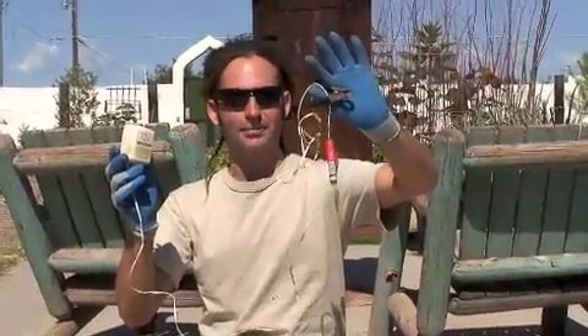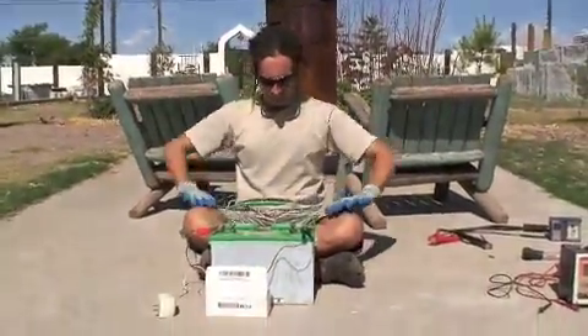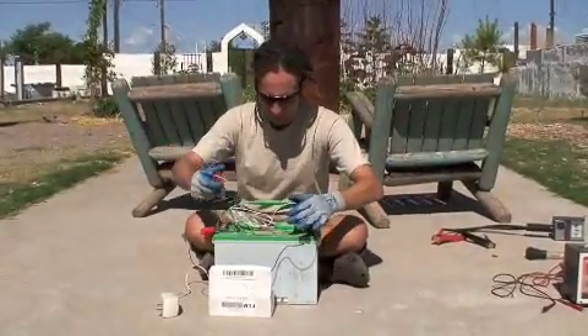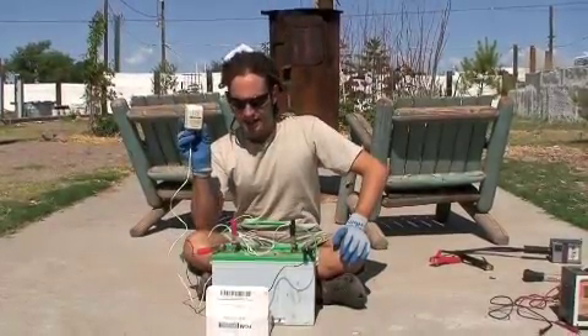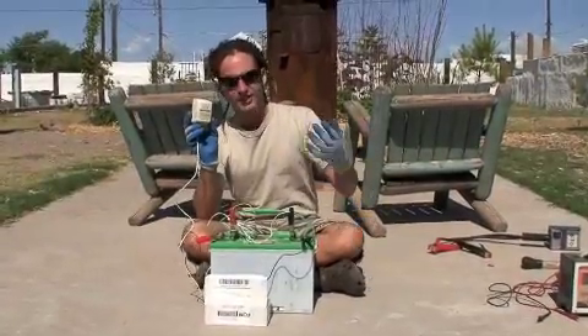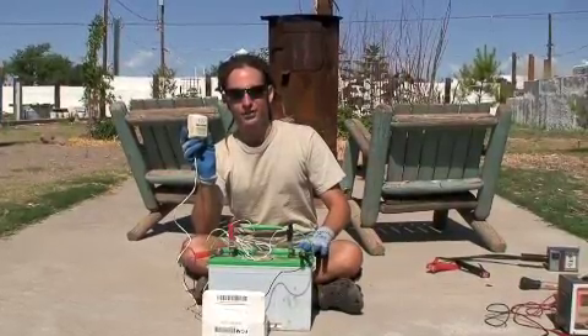This is a 12-volt wall wart plug — the standard kind you'd see in your house. You'd probably have boxes of these in your garage. All I've done is put some nice battery clamp leads on the end of this one. What I like to do is, while the desulfater is plugged in, plug the negative lead and the positive lead in the same fashion, then plug this into the wall outlet. The idea is that while the desulfater is running and taking energy out of the battery, this charger is trickle charging the battery and making sure it doesn't go too low.